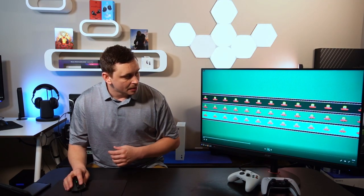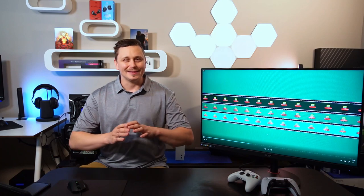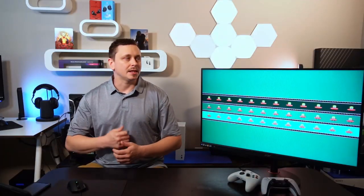Bumping up to the normal overdrive setting, the top and middle frames are about the same, but the bottom frame has actually improved. There's a tiny bit of ghosting on the top and middle refresh rates, but I can make out objects with crisper, sharper lines than with the setting off. The UFOs have clearer defined edges and less smearing or ghosting — so normal is actually a better setting in my opinion.